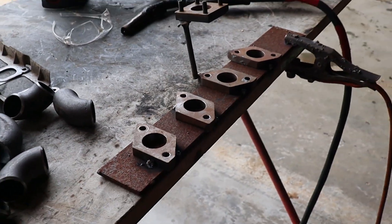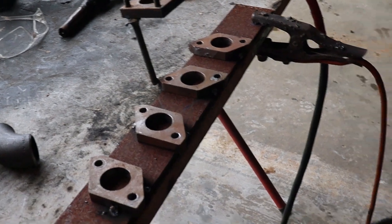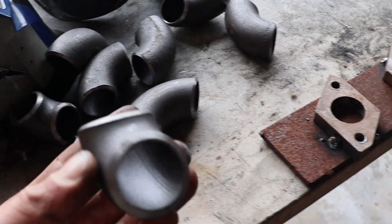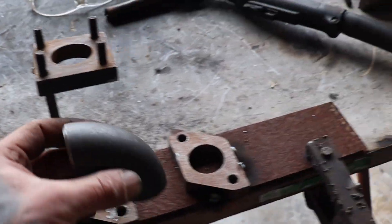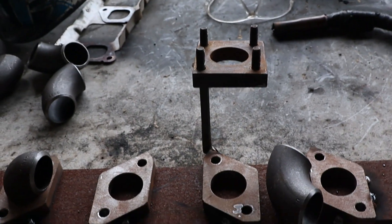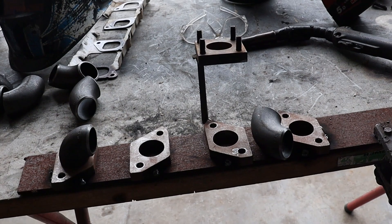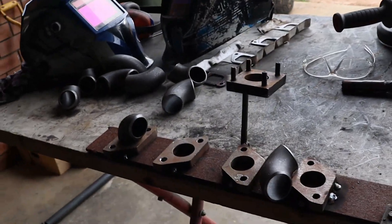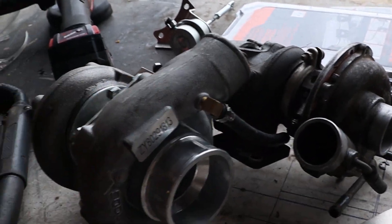What I've got here is just a jig to hold the flanges to make my manifold. I'm using a whole heap of inch and a quarter bends — you just lay them in there and join it up with some pliers so it all comes out there. Start with that and progress from there. We'll get this manifold sorted, bolt it to the car, bolt these turbos back onto the car, and then we can start on with the rest.